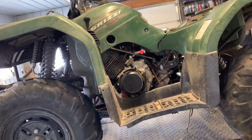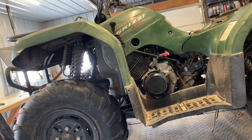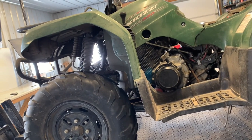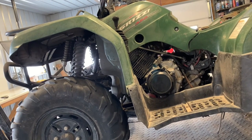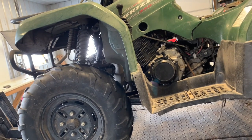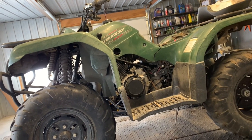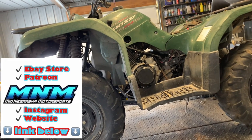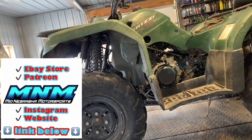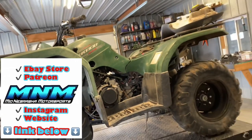That is the Yamaha Grizzly 350 — this is a 2010 model. It's an automatic two-wheel drive, oil-cooled little four-wheeler. These are awesome machines, we absolutely love them. One of the common problems is those regulator rectifiers. Another common problem is the rear end, and I'm going to show you that when I get into it. Make sure you get the maintenance done on these — they hold about 2.2 quarts of oil, so make sure you're not running low. Check out our service video on this Yamaha Grizzly 350 where I'll show you how to replace spark plugs, engine oil, oil filter, rear differential oil, and air filters for a complete service. If you found this video helpful, give us a thumbs up, leave comments, and let us know what else you'd like us to do videos on. Thank you so much for watching.